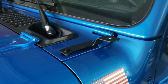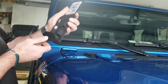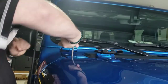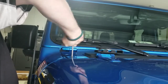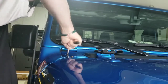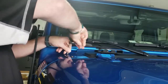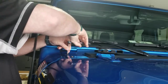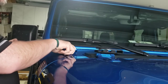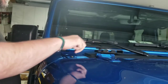Thanks for coming back. As I mentioned, we've got the cool little Jeep Torx bit set to take these cowl nuts out. As I mentioned on the other side, we will not be reusing these bolts because they are short and already have the spacers built into them, so you cannot reuse them for these mounts.